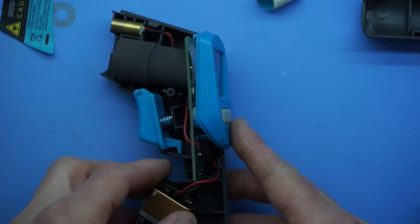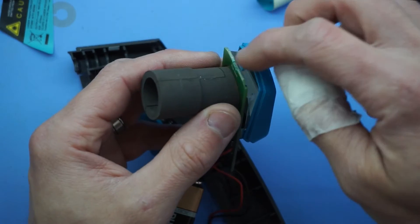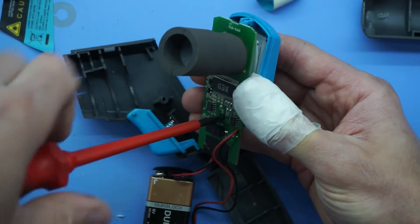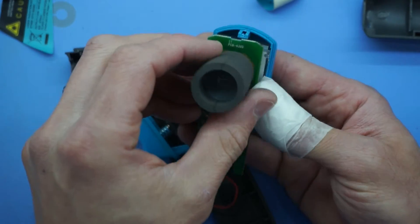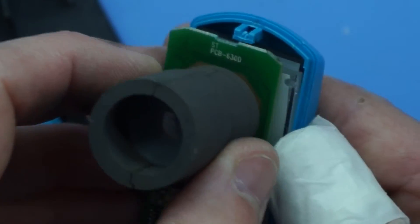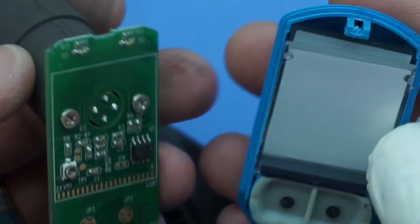There we go. Now I'm going to look at the power trigger mechanism — excellent. All pretty much in close proximity, should be able to lift this out. The issue with this one was when it dropped, this clamp bit over here popped off. So if I undo this screw I should be able to latch it up and over. We can see the PCB is marked ST PCB 6300. This is where the LCD normally makes its connection along here, so I'd say it's not pushing enough for the crystal display to function.